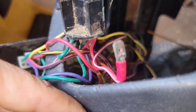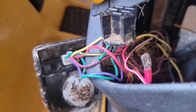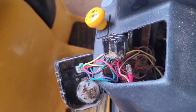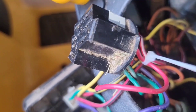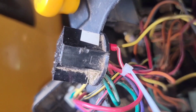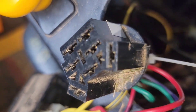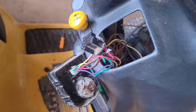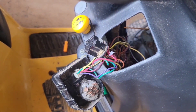So this red wire that's loose in the switch is the wire which has 12 volts to it. I don't know if I just pulled it out just now or if it's been loose all this time. So I'm going to try to secure it. It was jerry-rigged — it didn't have the right connector on it. But I got it so I think it'll stay in there. I checked it for voltage on this side and it's got 12.6 volts.